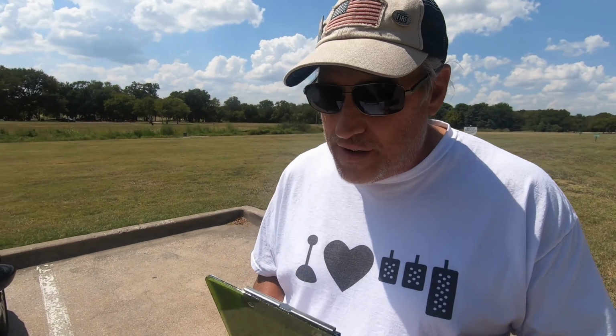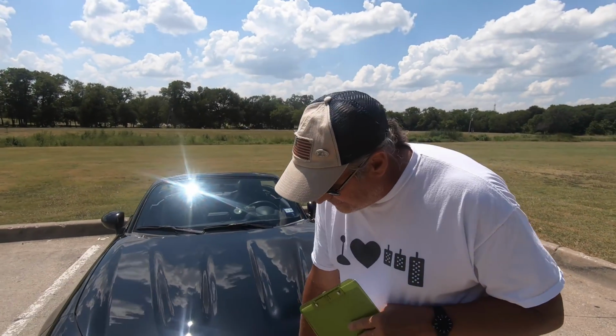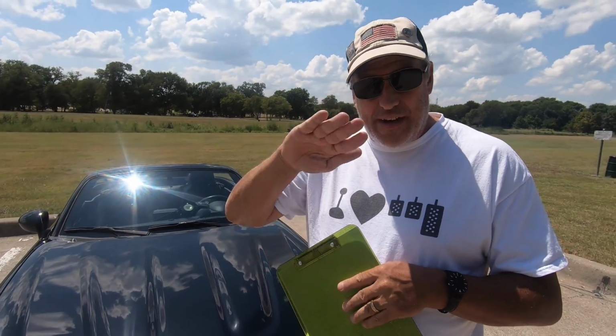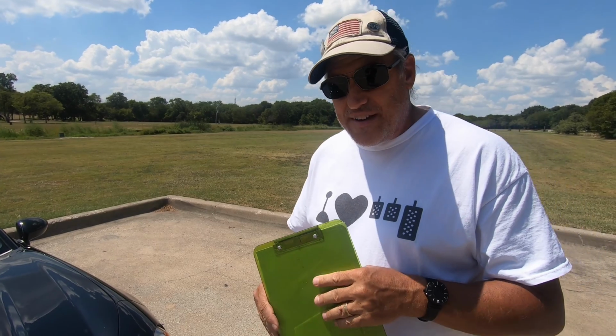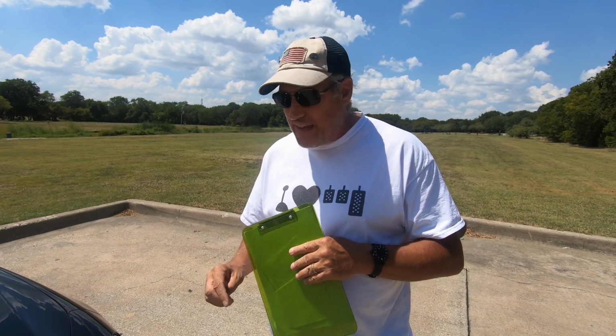I had them made for me. But in order to put them on, we had to grind down the covering of the Fiat badge, because it's curved and these are flat, so we had to grind it down flat. And because it's an acrylic, you had to be really careful doing that. If you ground it down too hard, it would tend to turn it to mush and it would ruin it, so you had to really take your time.